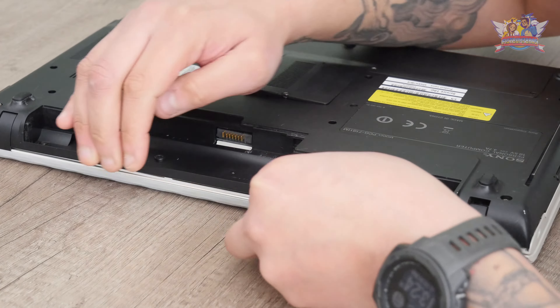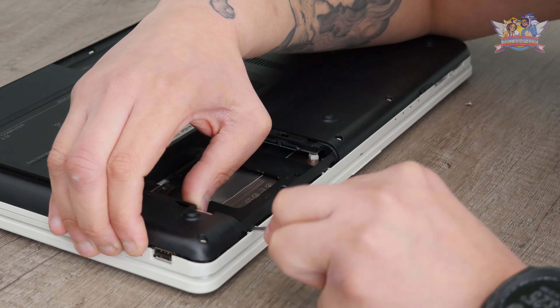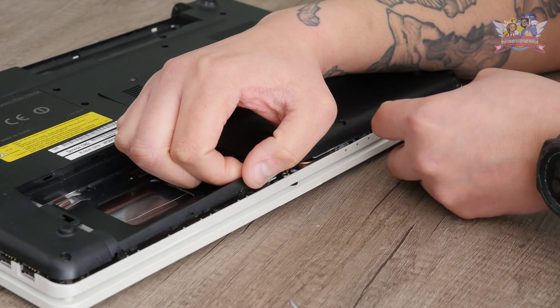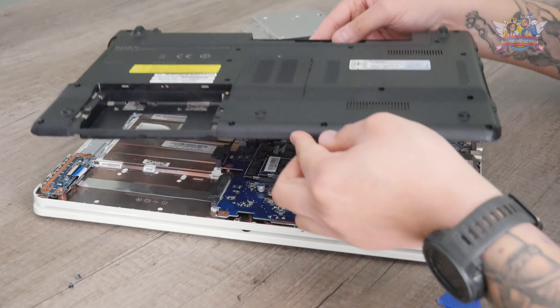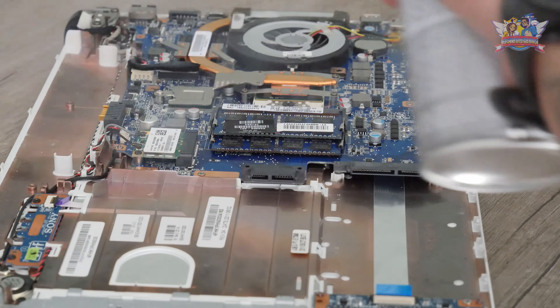But if I want to make this laptop more than just speedy, I need to go the extra mile. So I opted to open the complete back cover, easily accessible by removing tons of screws, then removing the plastic back plate. I have plastic spudgers to avoid breaking or damaging the plastic cover, but I started by using a sturdy screwdriver, as I need a bit more force to click out the clips. Opening up reveals something I ideally miss in modern-day laptops — just easy access to every component, if you ever need to replace parts.